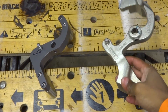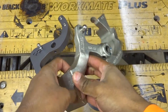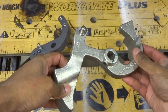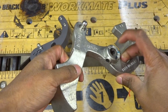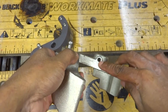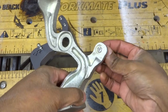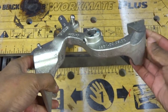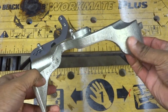From a technical perspective, this is the stock Ford short shifter. It is of cast construction — made in a mould with two final machining operations: one to drill the hole for the selector shaft and the other to drill a hole for the pin. The ball end is riveted to the outside, and it has built-in inertia weights which form part of the casting.